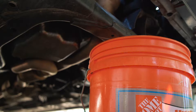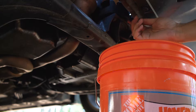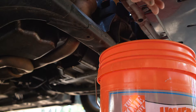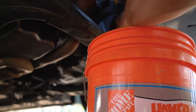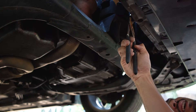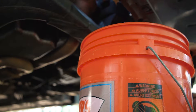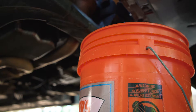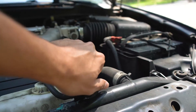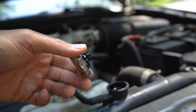So let's get the coolant drained out. After you get the little cowl off the top, come down here — you want to drain it. If you get under here you can actually see the drain plug, it's literally right here, my hand is touching it. I'm going to twist that out and drain all this coolant. This should only be hand tight. Then I pop the coolant cap off to give it more airflow — see how it started coming out faster.